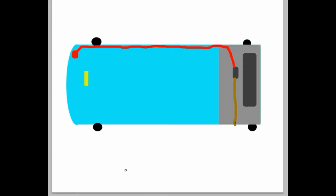Okay, so now we have the basic components. We have the power running from the battery to the amp, and our ground running to our amp. Now, normally when you get speaker wire, it'll be like 18 gauge or 16 gauge, even 20 or 22 gauge sometimes, depending on the size of your speakers. At Walmart or most places, there'll be smaller wires, and you'll have two for each sub. Let's say we have two subs here. We'll have a positive and a negative from that sub, and you'll see the plus and negative on each sub, and that's where you hook up those wires.